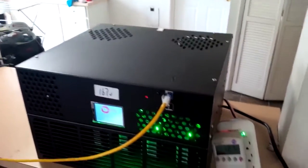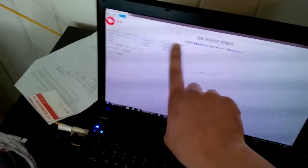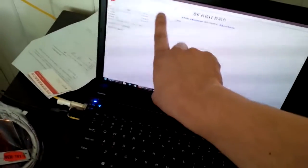And then you'll find out that when you log into the actual interface, it will be in Chinese. The first line right here, it goes across the top. That's your network information. This button right here sets network information. Now, you'd think that it would save the worker information and everything else, but it actually does not do that. So you have a separate button to set the worker information for your pool. So what you do is you set your information here and then put it on whatever your network is so you can get back to it. Then it will reboot, and to confirm the change, you'll see the new IP address right across here. So this is how you confirm. But you'll have no mining information, just temperature information. So that's how you know you have network information, but you do not have mining action going on.